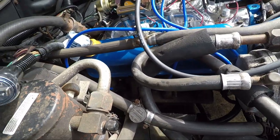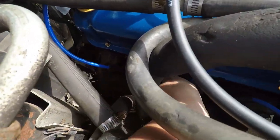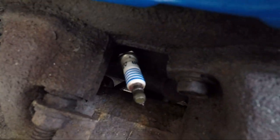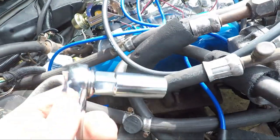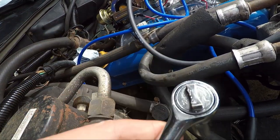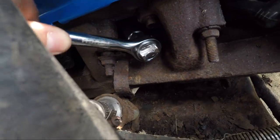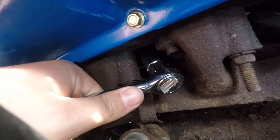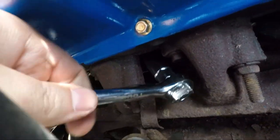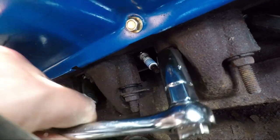It's actually fairly not difficult to remove a spark plug, which is a nice change of pace. Basically, all you do is you pull a little spark plug boot thing off, and then your spark plug is wedged in there, and then you take your deep wrench spark plug socket, flip that over to loosen because we want to take it out, and you get that on. It's a little bit of a pain to reach, but you get it on there, and you can just real easy take it off. They're pretty easy to work with. I mean, considering all the other stuff on the car, it's not too bad. So yeah,